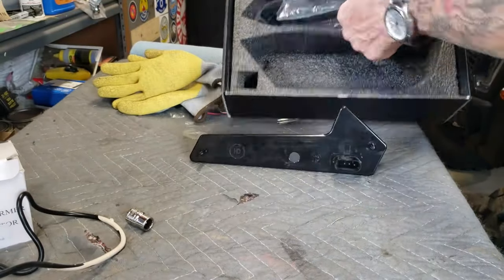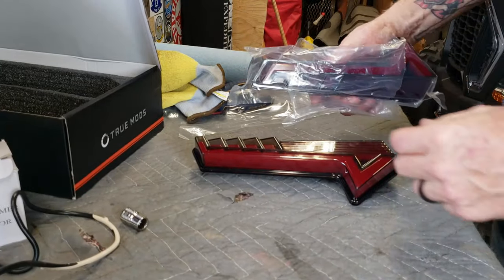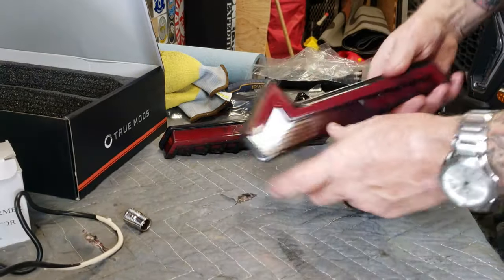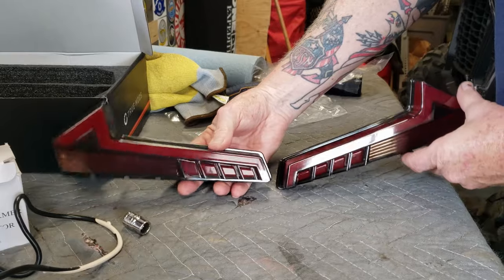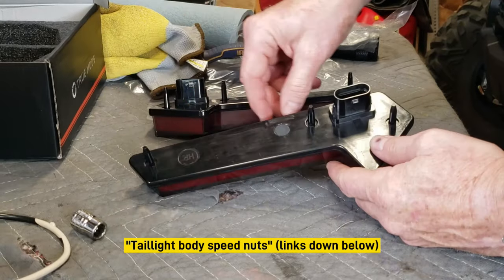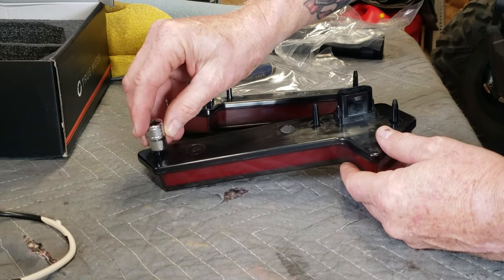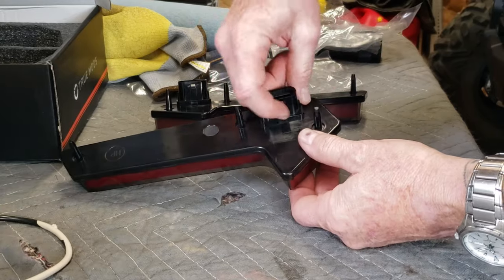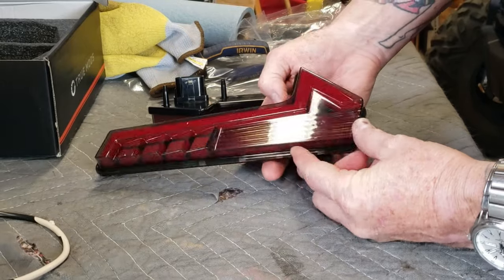Obviously I already opened this up. So in case you've never played around with the rear end of your Polaris before, they kind of go like that. On the back of them they have these little pressed-on rivet nuts that just screw and clamp onto the plastic. It happens to be an 11 millimeter. Basically you just get your socket on there, twist them off, and that's it. Be sure to unplug it — it's got an all-weather sealed plug. Pull the tab, pop it off, take these three nuts off, and pop the new one in. Simple as that.